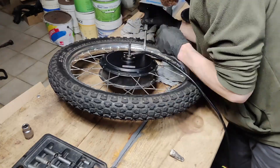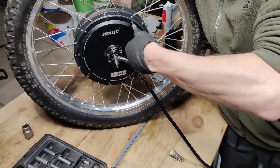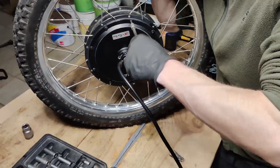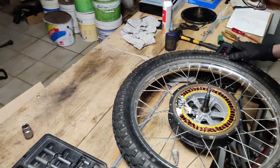When we have this fluid inside the motor we get a bit of drag from the fluid sloshing inside, but the heat generated inside the motor gets out quicker. At maximum speed the stock motor can overheat, while with statorade the motor should be able to run forever.